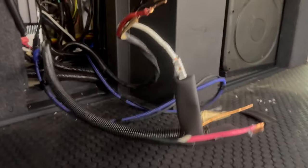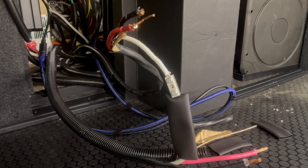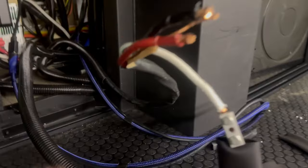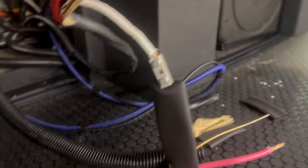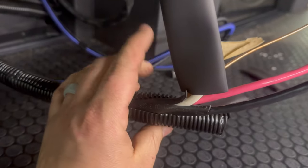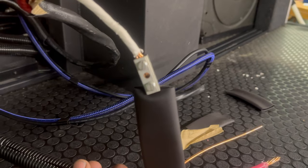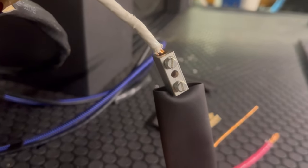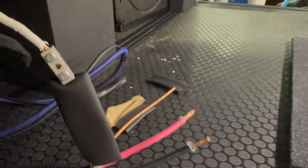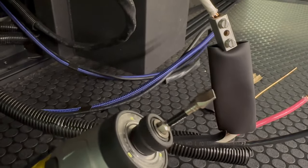All right, I'm in here getting the old shore power connected to the inverter in, or this is what used to go to the panel. And we're running this, and this is the cable that used to be the generator feed cable, generator pre-wire. And this is just how I'm hooking that together using these splices, and then I wrap that in heat shrink. And to get the connection real good, what I like to do is use an impact, whatever, straight bit.